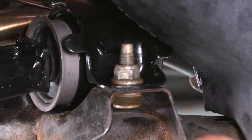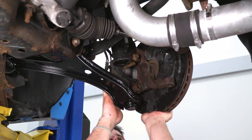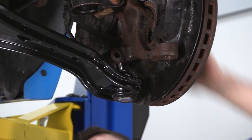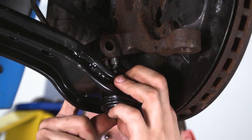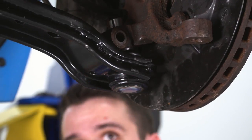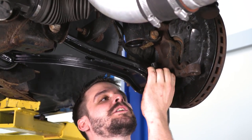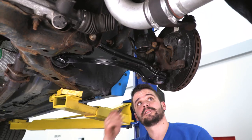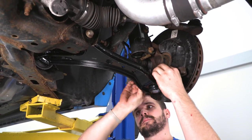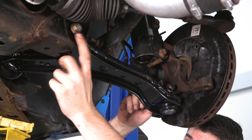Next, move on to the lower ball joint. Lift up on the spindle and down on the control arm. Get the seat below the ridge because that's where your bolt goes through to retain the lower ball joint onto the spindle. Hit it a couple more times until it's in place, then peek through the bolt hole to make sure it's lined up and send your bolt through. Tighten that up on the backside, and don't forget the bolt on the other control arm.